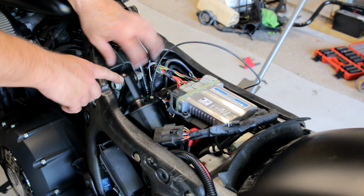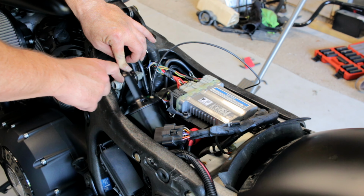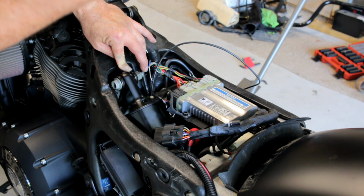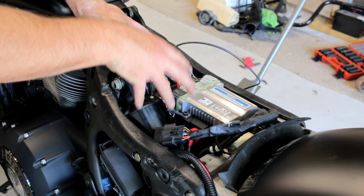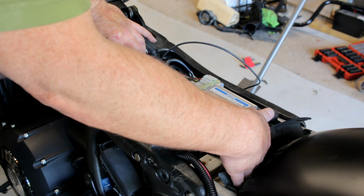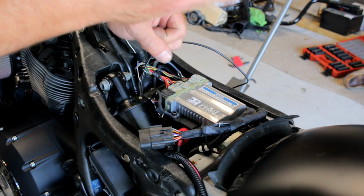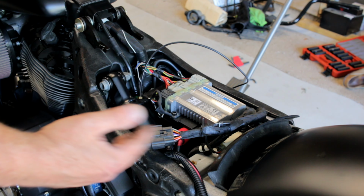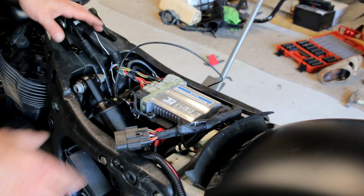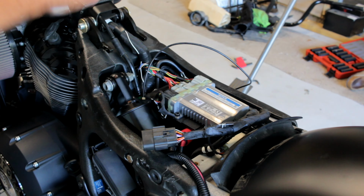One thing you want to watch out for is that on the new shock the bushings aren't really squished in real well, so it's gonna be a tight fit down here. It's a little bit more of a pain because you don't have a whole lot of room to work. What I did is we got it close, I came up through the bottom of the fender with a rubber coated handle of a wrench, and just kind of got it on there and tapped it with the screwdriver a little bit, watching it as we take the lift up and down a little bit in order to squish it in and get it aligned. Once you get it all lined up, slap the bolts in there, 18 on one side, 17 on the other, zip, zip, zip, and you're good to go.